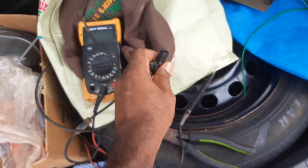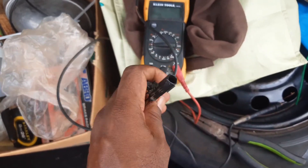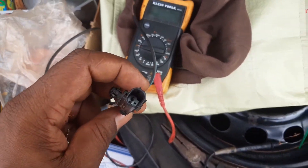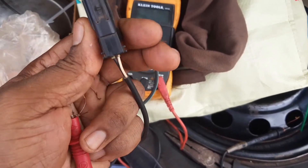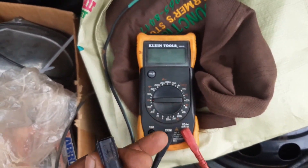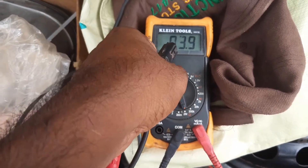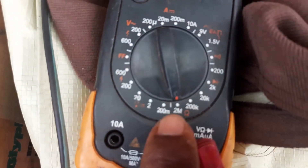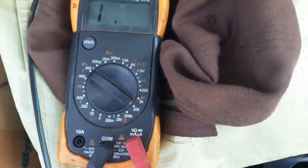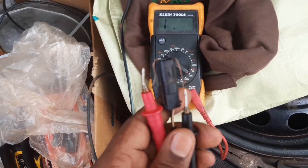It's going to be a bit difficult for me to do this because I need to ensure that this touches the pin. I'm just going to show you — put it on and show you the cable connection and how the meter lead is connected to it. Here is the meter and I'm going to put it on the mega ohm function. It doesn't necessarily have to be on that function, but since I checked it and it operates well on 20 kilo ohm, I'm going to use the 20 kilo ohm function.